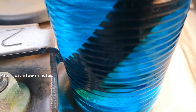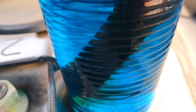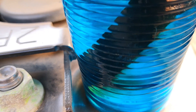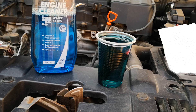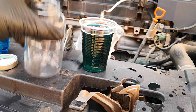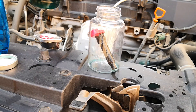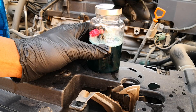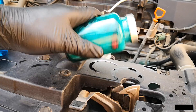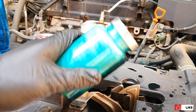As you may be able to notice, the color of the cleaning solution, particularly at the lower part, is turning brownish — which is just the cleaner working its magic on all the varnish and oil deposits. At the end of 20-plus minutes, the cleaning solution is now a deep green color compared to the bright blue we had at the beginning. I'll put the PCV valve into a container that has a lid, pour in the engine cleaner, cap it up, and shake vigorously. This ensures that the engine cleaner gets into all the crevices and breaks loose any remaining debris.